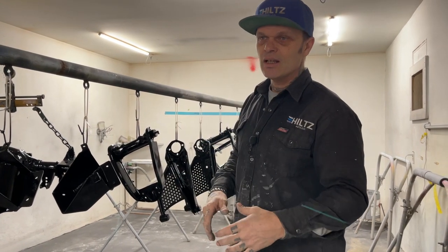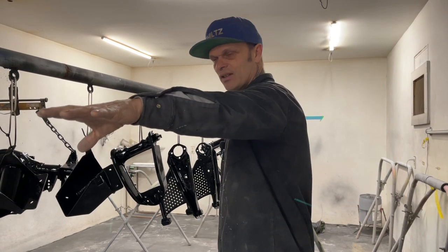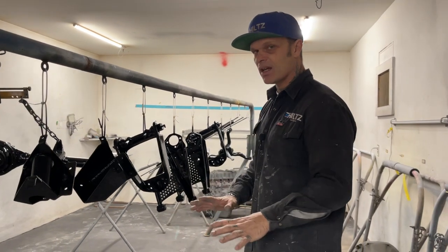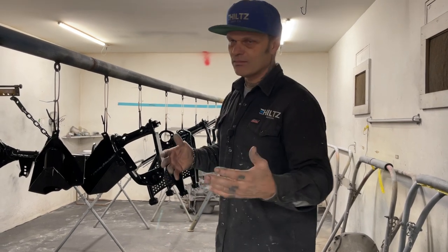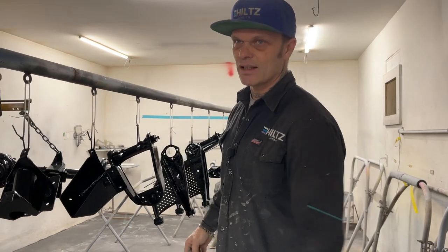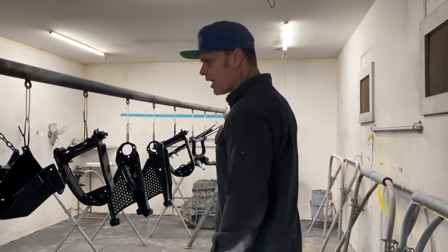And basically, too, where we are a little bit dirty in the shop here, where it's got the plastic on, is gathering dust. We're just going to take our time. When we pull that off, we're going to leave the dust on the chassis. We're not going to wipe it. And I'll tell you why you do not wipe, because it scratches it. As soon as you have a little bit of dust on a chassis or any paint at all, and you wipe it, it's like sandpaper, basically. But we're going to try to put that on.